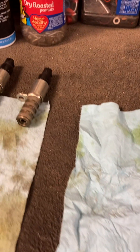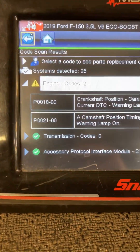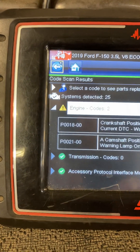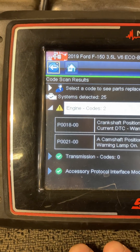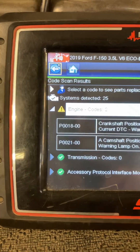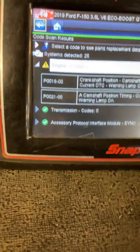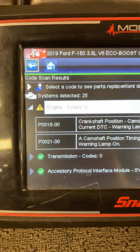Tristan at Truck Lab with a short video on the Ford EcoBoost variable camshaft timing solenoids, or VCT solenoids. We had a 2019 F-150 3.5 liter EcoBoost come in with check engine light, occasional loss of power, and a cold start rattle that is usually indicative of the phasers failing. The customer hadn't mentioned the cold start rattle — we heard it the day after it was dropped off.